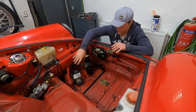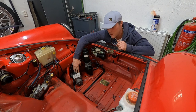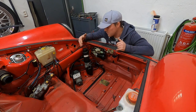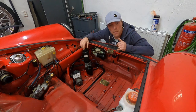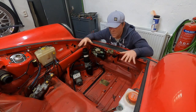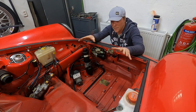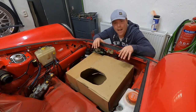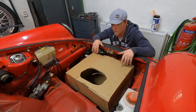For the front layout I'm thinking: put the new four-channel ABS back close to where the old one was, so you have a nice connection to where it goes into the car. Power steering — put it as far up front as possible; these are pretty heavy so I'm going to look into the Porsche unit which might be lighter and a slicker unit. I'm also thinking about the fuel tank setup — you could either go with the original tank or go with something more race-oriented, which would be a fuel cell. This is how a 65-liter (17-gallon) fuel cell tank would look in a car like this.